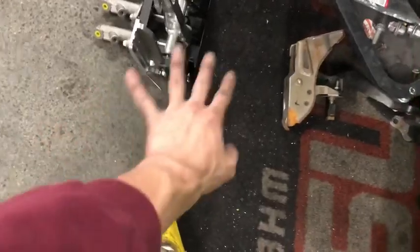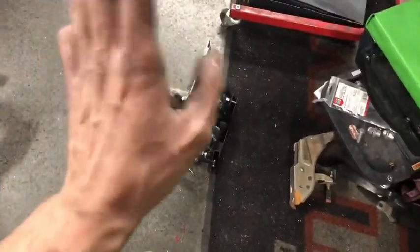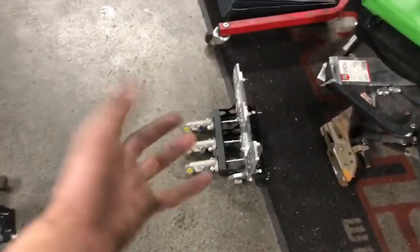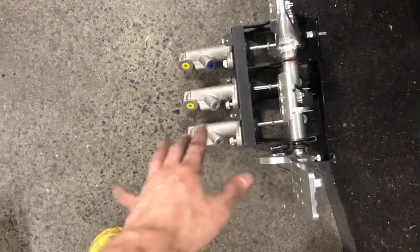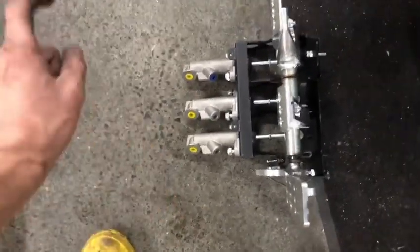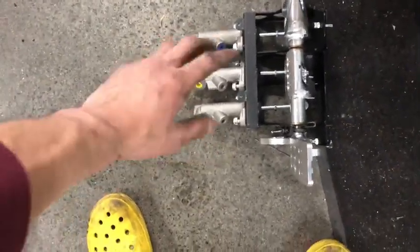I needed to find a way to get a brake switch, so whenever I hit the brakes on the pedal box, the tail lights know they have to turn on. There's a couple different methods to do that. The best, and nicest-ish way, I believe, would be to have a PDM and run a pressure sensor inside of the rear brake, and you control the rear tail lights according to that pressure sensor. The next step after that, you can just get an actual pressure sensor that's just an off and on switch. I just don't know which pressure sensor to get. And the third way is to try to use an on-and-on switch, kind of like the stock one is.